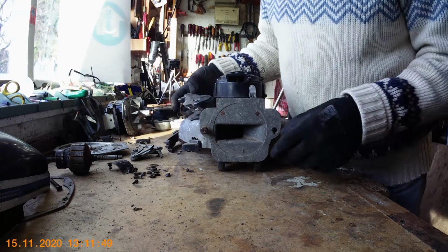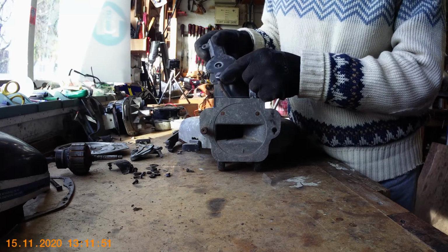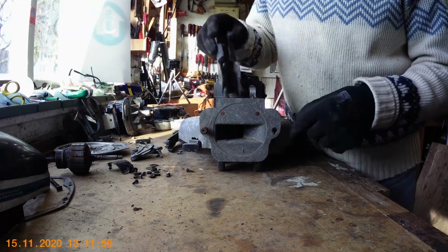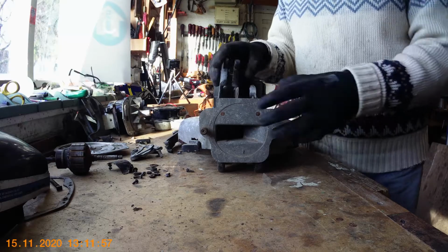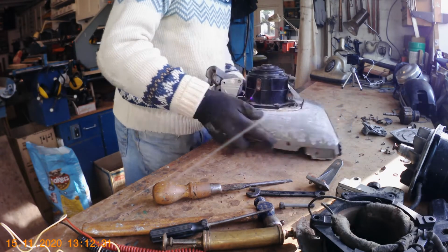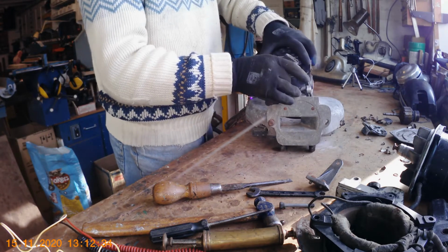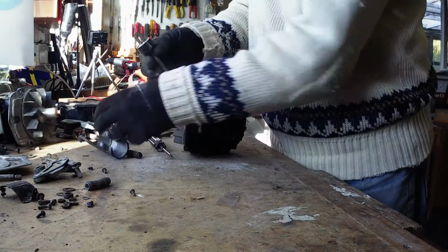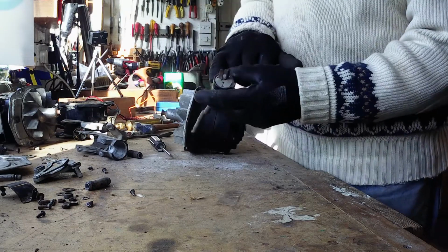It's a common thing. The other thing that happens is that piece wears away on the handle socket, or the pit breaks off, and then again the handle just flops down. So having got that off, turn that round, you can now lift the whole motor out complete with the handle socket, and just pull that out of the handle socket like so, and you'll see this one's got 2 pins